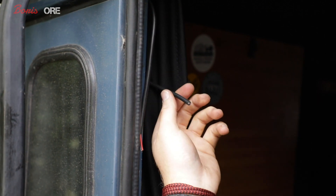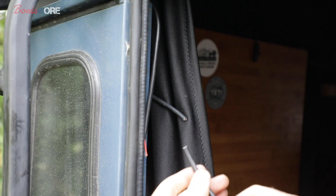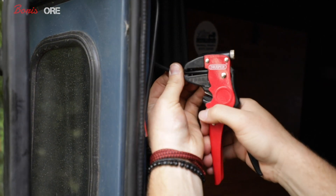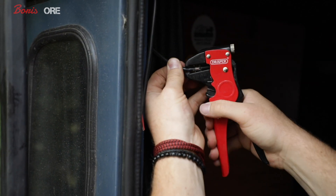So here we've got the wire coming from the dash with the switch and here's the new light wire. What we need to do is use a length of wire and join this and this together and then another one into the new light on the other side. Pretty easy — I'm just going to solder them together and heat shrink, but you just need to strip the wire back and attach them together.